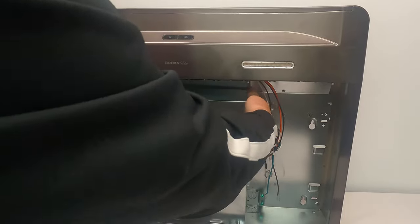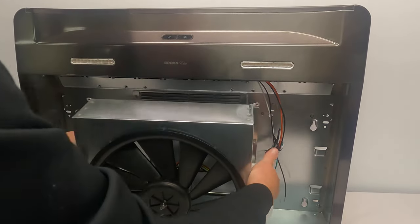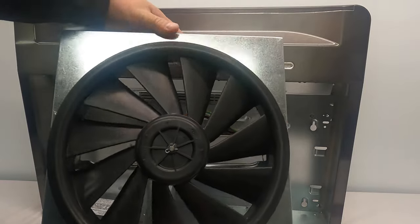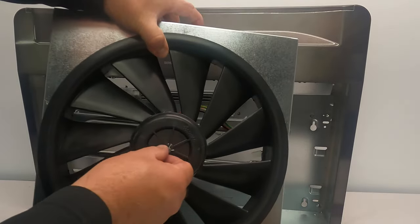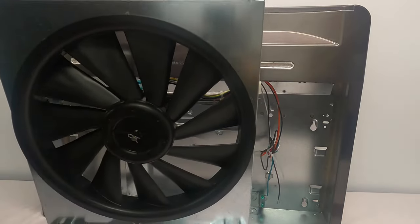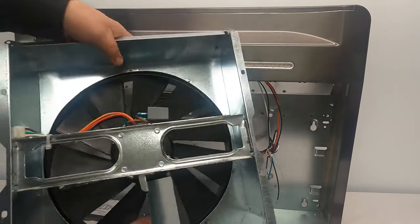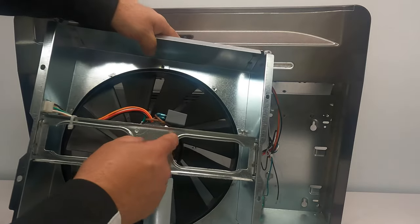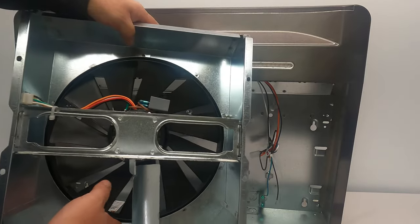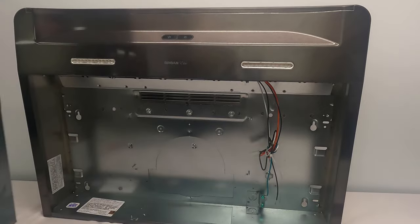This blower box will lift right out. This is what the blower housing looks like. This is a hairpin clip — if you took this hairpin clip off, this wheel would just pull off in case a fin broke. Here is the back of the motor; there are four little bolts screwed into the motor if you ever needed to replace it. Pretty simple.